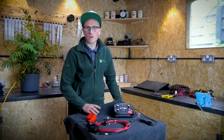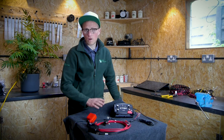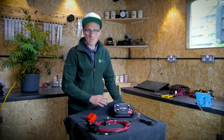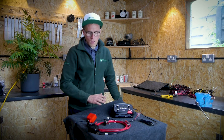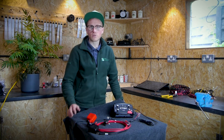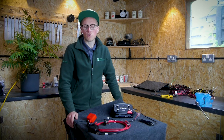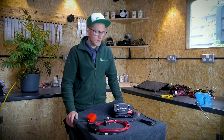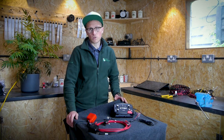This particular unit is one we've been using for years — it's very tried and tested, proven reliable, and it's got a lot of great feedback. CTEK are a great company. We would use this in a vehicle to charge up the leisure batteries from the vehicle's engine whilst driving, and it also separates the batteries so that when we run our leisure batteries down it doesn't flatten the starter battery.